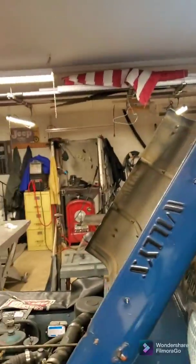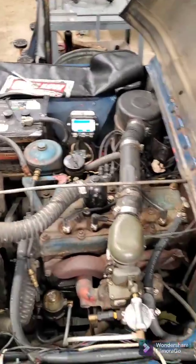Hey guys, it's been a long time since I made a Jeep video, so I thought I'd show you something I'm working on here. My CJ2A is still a 6-volt system with a generator, and I have no desire to change that. But I've kind of wanted to have a way to keep my cell phone charged, maybe plug in a GPS. And I found out about this little power converter that converts from 6-volt up to 12-volt in order to charge a small thing like a cell phone. So I picked one up and I'm going to show you this.